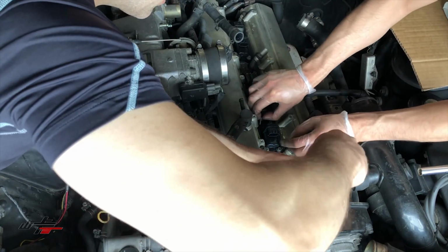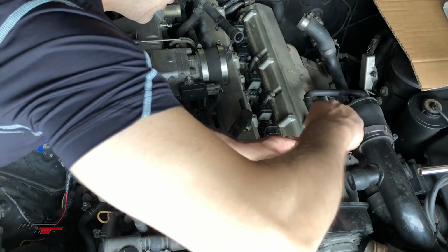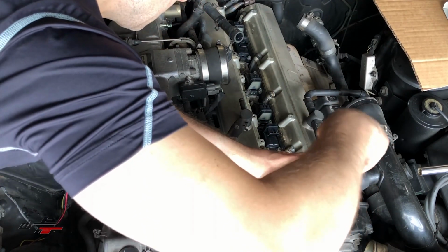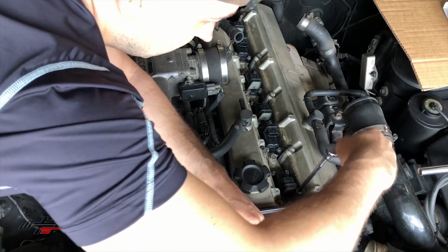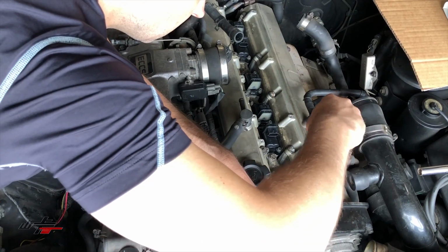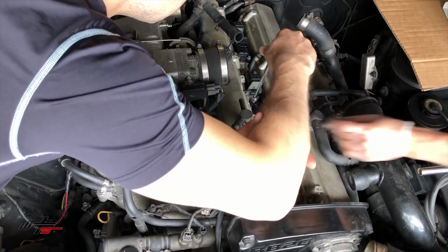And these are not going to take a lot of pressure to bolt down. Don't over torque these. It is a metal flange on the coil, so you could torque it and it wouldn't probably hurt it much, but just don't go crazy because you're putting it into aluminum. Right, for sure. And the reason why there's 4 of them is just to keep them level. The bolts are there just to hold them in place, and not necessarily to torque them in any sense. I would say, go until it seats and then a quarter turn is probably enough. No more than 10 pounds. Couple holes there.